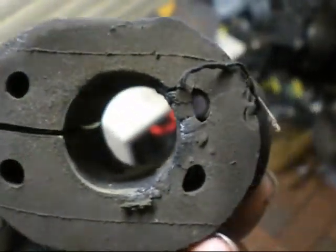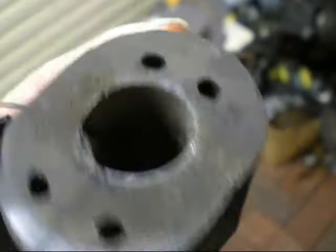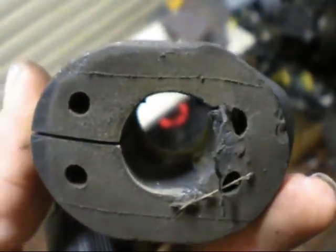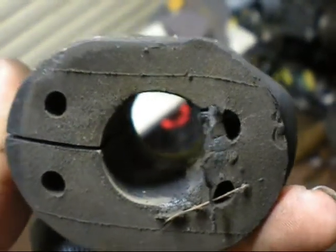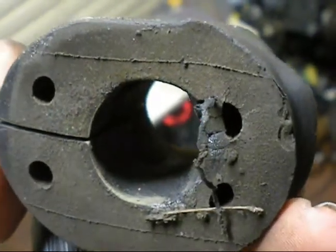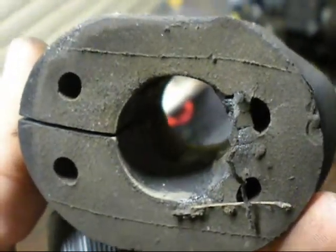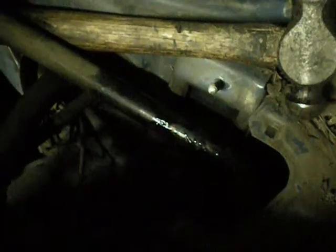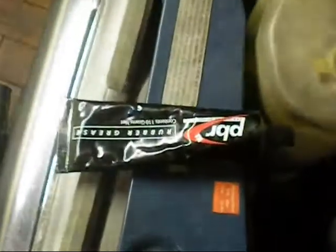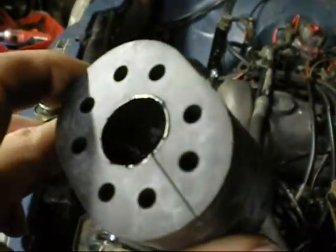Here's the old one. As you can see it's a little bit sad — it's not so bad, but it's crushed out the side closest to the wheel. These are very important to the handling of the car, so always check these in the W123 models and later. I've greased the shaft and worked the grease into the hole until it's nice and wet. Always remember to use non-oil based grease. There we go — nice new bushes in place.